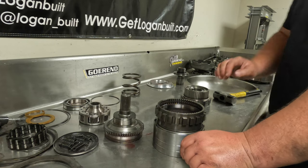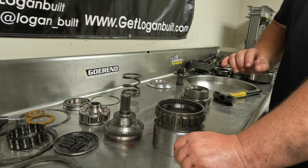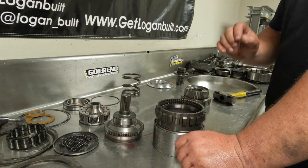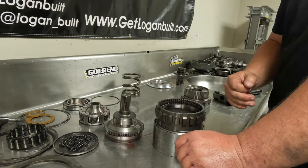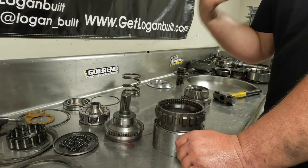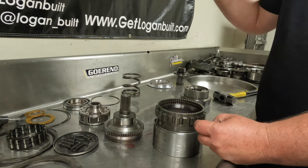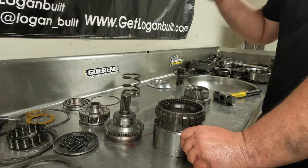So that's pretty much what this video is going to entail in part two. We've got everything taken apart. Now I'm going to get everything in the washer, get it all clean and dried — there's really no reason to videotape that. When we put all these pieces back together, I will show you step-by-step examination of what to look for as you're going back together. For me, examining transmission parts is a three-step process: I'm looking at the parts as I'm tearing the transmission down, looking at the parts again as I'm tearing the internals down, and then inspecting the parts one last time after I clean it as it's going back together. The next video we will be working on putting this back together.